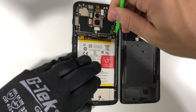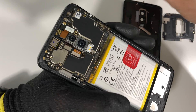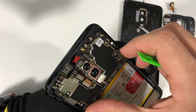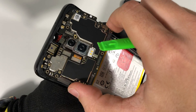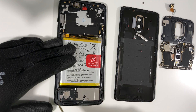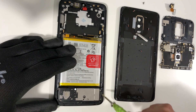With all the flex cables and antennas disconnected, we can wedge up on the motherboard with the plastic prying tool — gently squeeze in a small gap and pull up on it. We're also going to need to disconnect the front camera which is still holding it down, and the small flex cable that connects to the loudspeaker. Disconnect those and then wiggle the motherboard and it will come right out. Moving on to the bottom portion of the phone — there are seven small Phillips head screws to remove with the screwdriver.